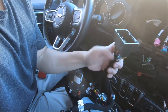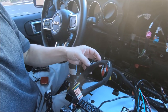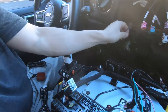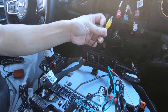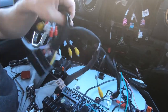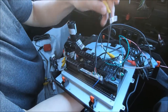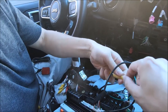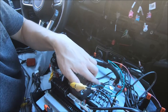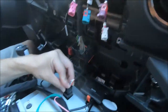The easiest one is the box connector. One thing you do have to remember is to connect the factory LVDS cable for the camera. There are two portions to the camera: there is the factory LVDS cable which comes from this bright red connector, and you also need to connect the male RCA which comes from this board right here. This male RCA rear-view camera needs to connect to a female RCA — the one we connected up here on the far left. Connect the RCA here. Now that you've connected the RCA, you still need to connect the LVDS. For the air conditioning, you also need to connect this plug.